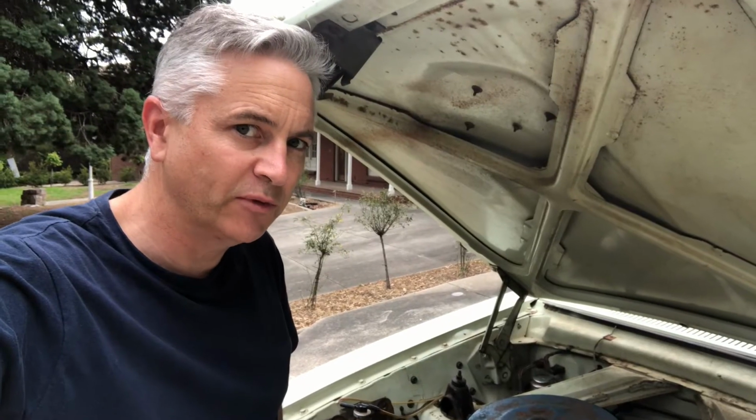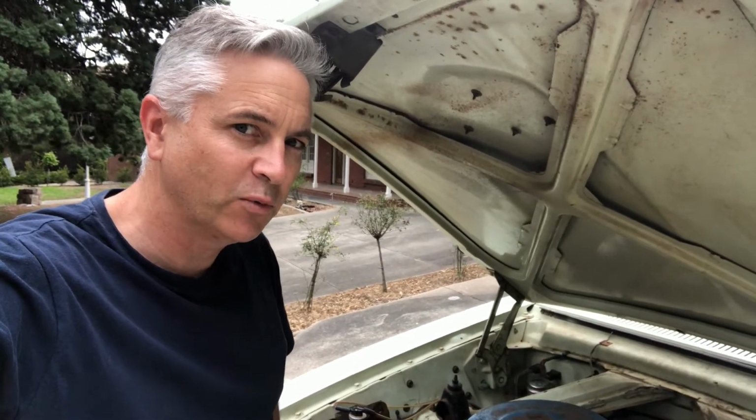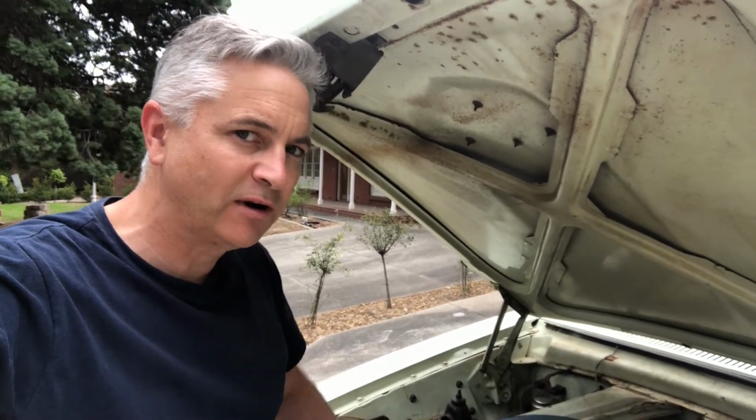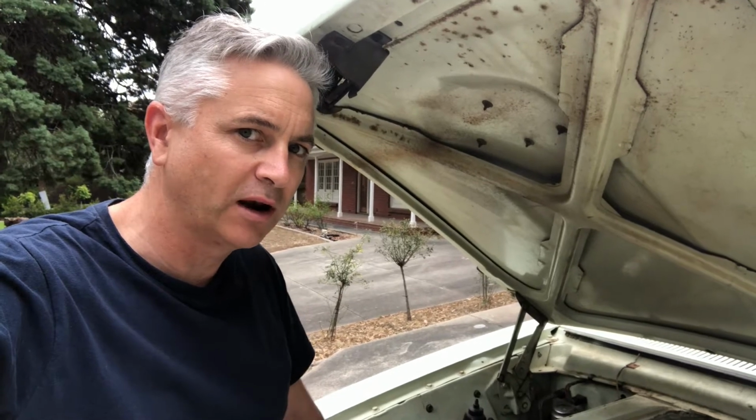Now what I'm going to do, before I add new coolant to the vehicle, I'm actually just going to fill it up with water, run it for a bit, drain it again, and then I'll probably fill it up with water another time, drain it, just so we get all of that flush treatment completely removed out of the system before I finally drain it and fill it up again and add the coolant to it. So folks, I've literally flushed it 2 or 3 times now. So let's release the water that's currently in the cooling system and let's have a look how it looks.